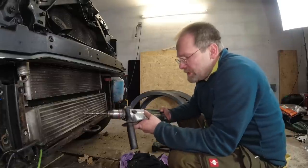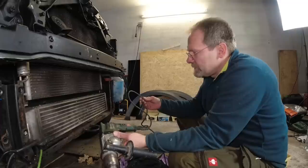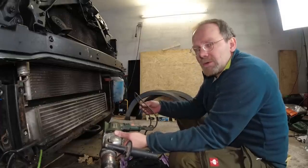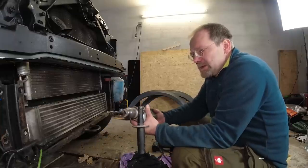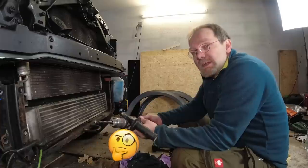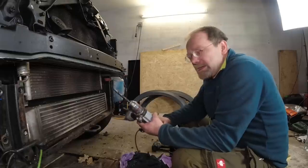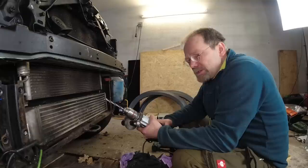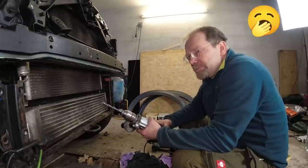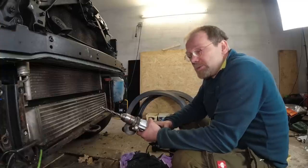Any residential home in Germany has 230 volts AC power, there is no 120, and any outlet you can draw up to 16 amps, some of those even 20 amps, which gives us twice the power than what you guys in the US have out of your 120 outlets. In addition, every home in Germany has three-phase power. So we got 3 times 400 volt AC, 50 hertz, and in newer homes, you have about a 80 amp drop. In my home here, I got a 180 amp drop. This is industrial grade.